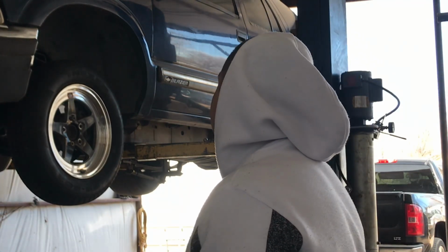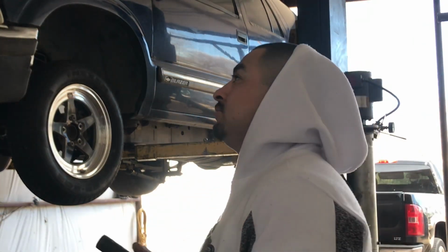So my boy Brian came out here, he came and picked me up, you know what I'm saying, took me home. And bringing it home, I tear it down. And like I said, I torched the head and all that. But then again, like I told y'all that day, I had got bad fuel from a different company also, because the company that I usually get it from, or my connect, wasn't available at the time. So then I had to get some from somewhere else, and I blew the head gasket. And then this time I did the same thing, changed fuels, and I blew the head gasket again.